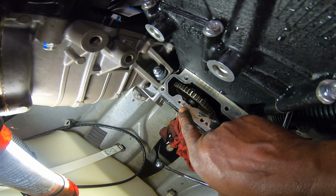I know for the newer models that there's 12 bolts. There's one bolt that has a blind hole right in the center bottom, so you have to make sure that you get that one. You're going to need a long hex socket or a long hex key to get to it, but it's 12 bolts. And just make sure you check the O-ring and the gaskets before you mount them up there to make sure you don't pinch it. All right, that's that step.